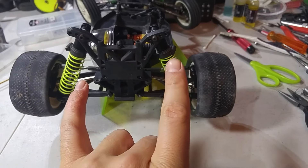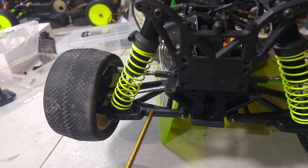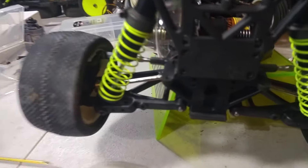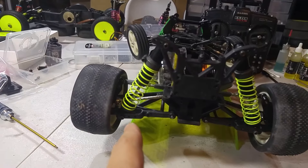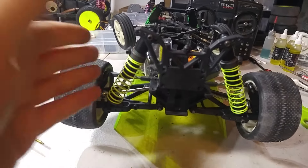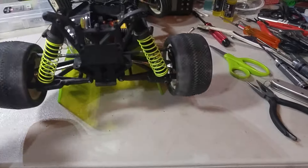One thing about setting up the arms — because you're moving the bulkhead and shock tower from the middle of the car to the back, the shock mounting also moves back. These arms are not front-to-rear symmetric; there's only one side of the arms where you actually mount the shocks. In rear motor configuration this faces forward, but you can't just flip the arm around because the arm has a dip in the middle. So what you have to do is take the left arm and move it to the right, and take the right arm and move it to the left. But when you make that swap, don't swap the hub carriers — keep the left hub carrier on the left side. If you move the left arm with the left hub carrier to the right, you go from negative toe to positive toe. So swap the arms and put the hub carriers back on.